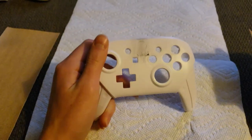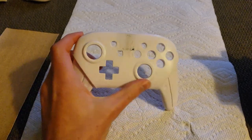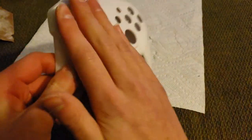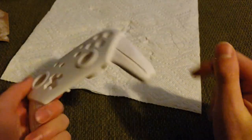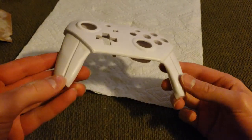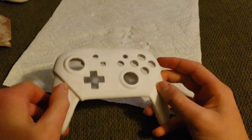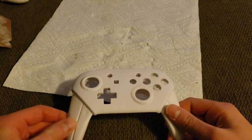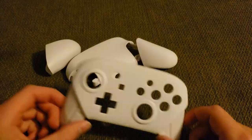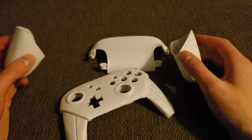The logo came off pretty cleanly — that's a good sign. Once you're done sanding, you want it to be pretty smooth. I finished the front of the controller with the 140 grit and it's a matte finish now. The logo came off pretty well. I only sanded the front part since the interior areas won't be seen and it doesn't matter as much if paint sticks there. Now I'm going to move on to 150 grit. I've gone ahead and sanded all the pieces — back and the two handles — and the next step is to go outside and start painting.